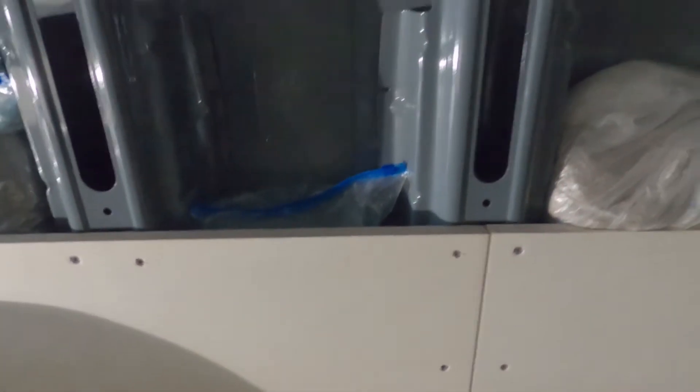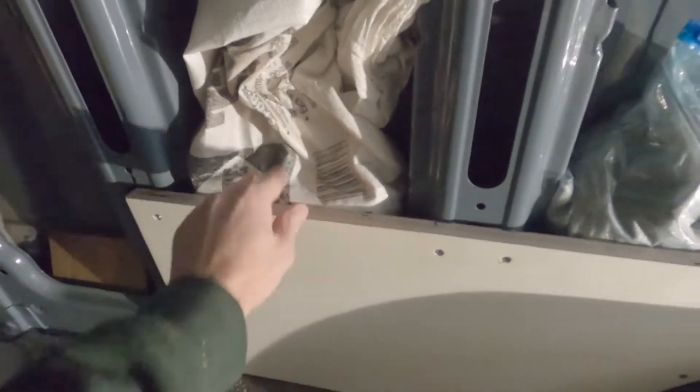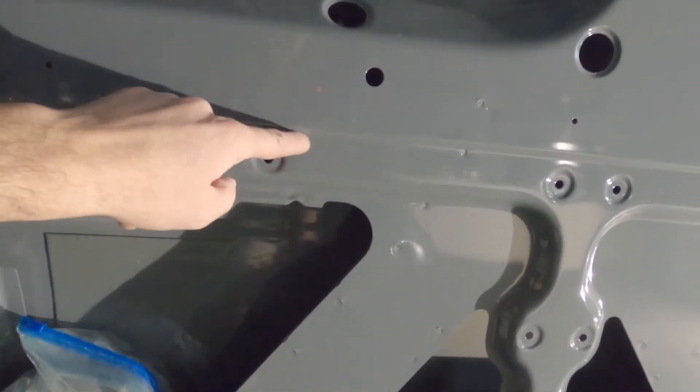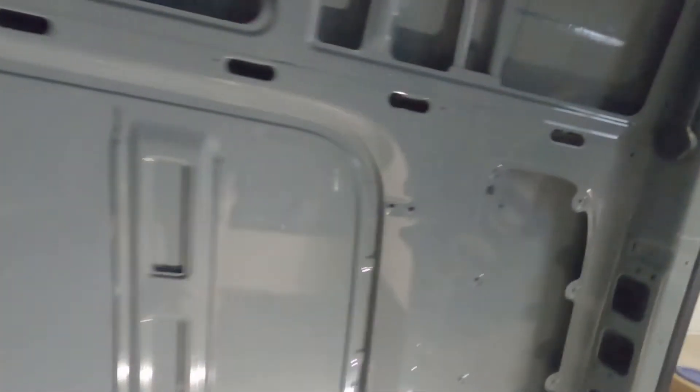The next sheet I'm going to do the same thing — leave a space between them. You can see here we've got bags of sand. I'm actually sticking them in the wall. We've got these gallon bags — it looks like we're hiding drugs in the wall, but I promise it's sand. Here are the sandbags. When we got down to the bottom, we just put the bags in the wall themselves. There's a lip right here, so I'm going to run these up to that and then run my next sheet down onto that. In here you can see these are set back from the framing, so I got some one-inch foam board and some quick grip construction adhesive, then I'm going to stick these to the back of the plywood so they're hopefully not going to rattle around. We're going to screw it like crazy in here and hopefully knock down some of the noise and make this thing ride down the road smoother and have more traction in the winter.